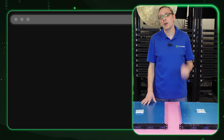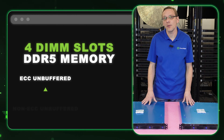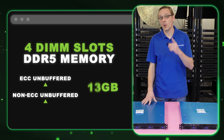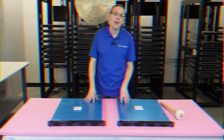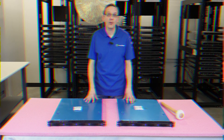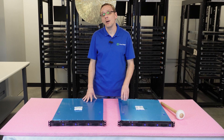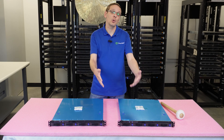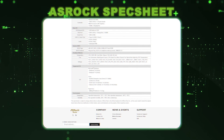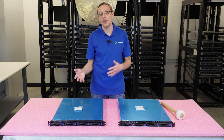As far as the RAM inside, there are four DIMM slots and it is DDR5 memory. The types of RAM you can use are ECC-unbuffered and non-ECC-unbuffered. You can use a number of different sizes: 8-gig, 16-gig, 32-gig, or all the way up to a 48-gig module. You can use speeds of 4,800, 5,200, or 5,600 with ECC-unbuffered. With non-ECC, you can get 5,600. We encourage you to check ASRock's spec sheet for all the different specced modules. On our website, the drop-down configurator will show the different options — generally we're putting in 32 and 48.